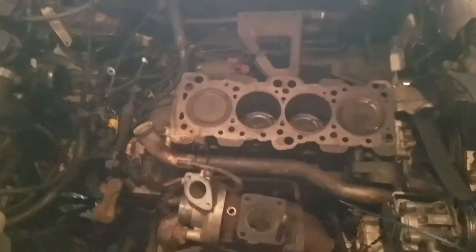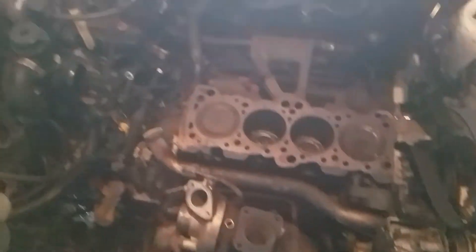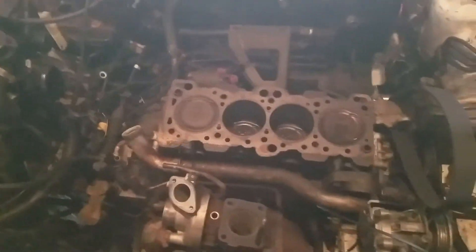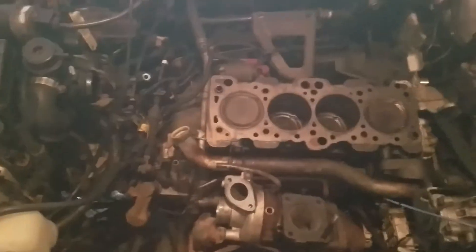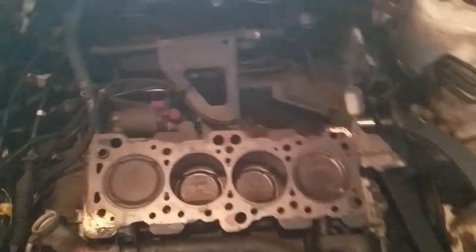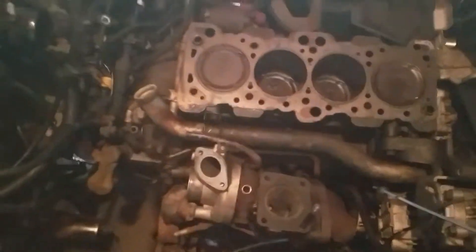It's just metal shavings throughout the whole inside of the oil pan, so I'm in the middle of rebuilding a block. I do have a brand new block, brand new crankshaft, rods, pistons. It's pretty much — I'm going for big this time. I mean, it's already torn apart, might as well do it all now while she's separated.